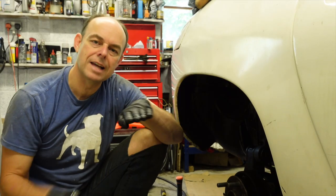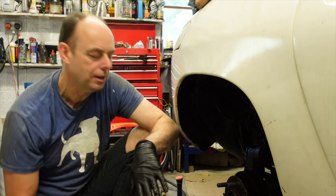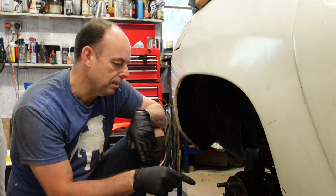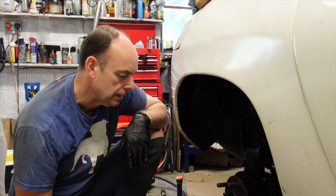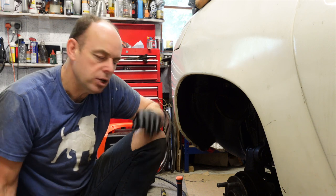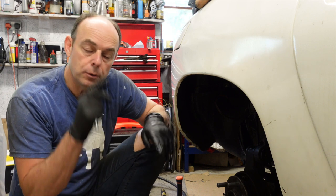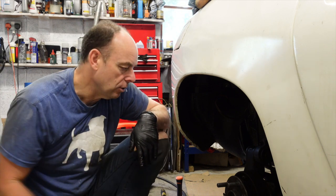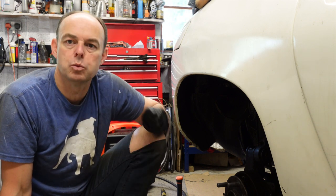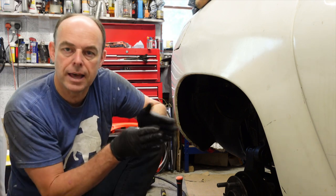I quite often get lost exactly what I show on my videos and what I do in the darkness, in the late of the night. But just to update, what I'm trying to do is take out the pivot pin that sits at the bottom of the rear suspension. They're notoriously hard to get out, now I find out. Initially I took the nuts off both ends, came off really easily. I tap it a little bit and it moves backwards and forwards. And when I took the nut off, the rear end looked like it had been cross-threaded. So I was like, oh, okay, so the pivot pin's junk anyway, so let's just whack it with a hammer and get it out. So I gave it some good whacks and it came forwards as far as I could get, as far as I could hit.